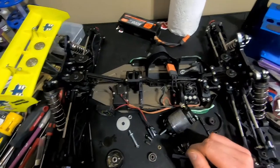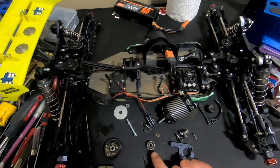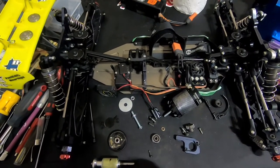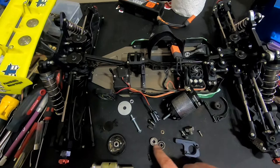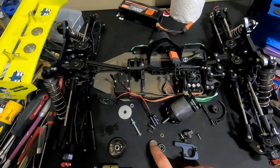I checked the manual — I kept it because it has the bearing sizes in there. The front bearing is 5 by 16 by 5 millimeters and the rear is 5 by 11 by 5 millimeters. Kind of odd sizes. I ended up finding a spare front bearing but I dinged it with a screwdriver when I tried to install it in another motor.